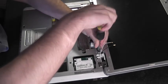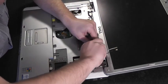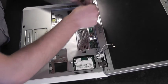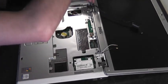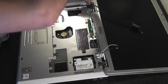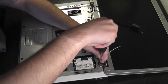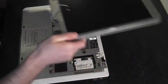Release the display ribbon connector, pull up the display ribbon by grabbing the blue label and pulling it straight up. Take the ribbon out of the channel. Now we're ready to take the screws out. Push the screen back as far as it goes and remove the screws. We can now lift the display assembly clear off the laptop.